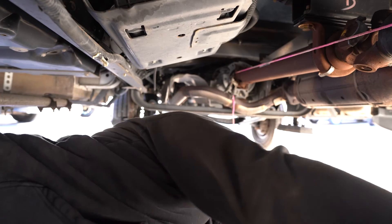Let's go drive this thing. Typically around town driving you may not notice that your drive shaft is truly out of alignment — it's when you get on the freeway that you really start to notice that vibration. Typically on the freeway we would get a drive shaft vibration between 62 and 65 miles an hour, coming on and then usually going away between 67 and 70 miles an hour. Right now we're driving right at that 65 miles an hour to see if it has any vibration, and it really does not. It looks like we did a good job.